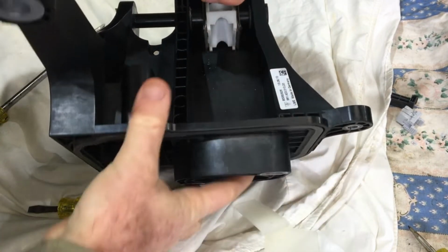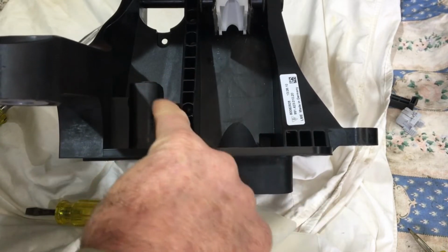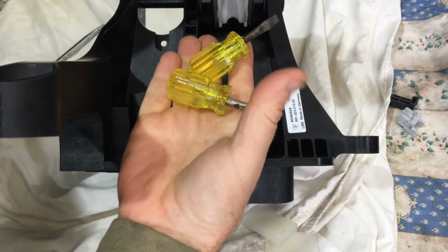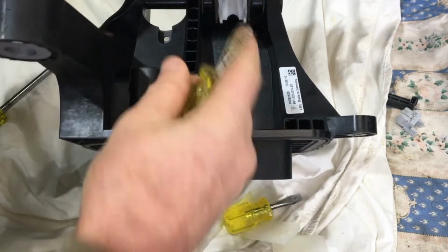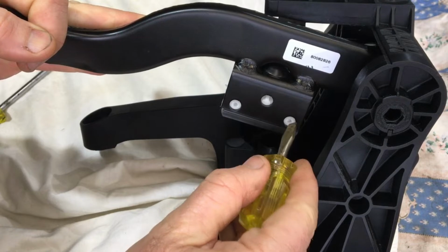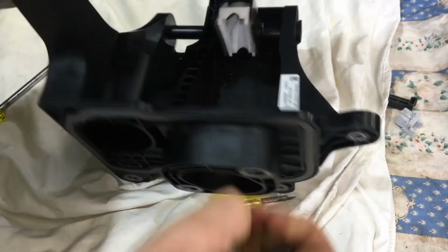You don't have much room because you're going to be looking at that as you're lying on the floor of the car looking upwards at it. There's also a big electrical conduit which is about so thick, so you've only got about that much room in here. So you'll need a couple of flathead screwdrivers like that, where you can get here and lever this thing out. The problem is on each side there are a bunch of little bumps that go into these holes which you've got to lever out, and when you lever out one side it just wants to constantly jump back into the other side.